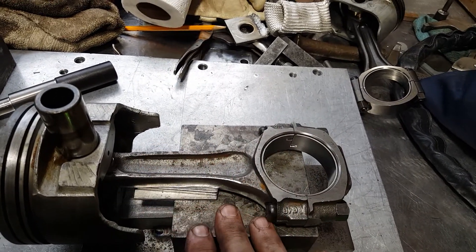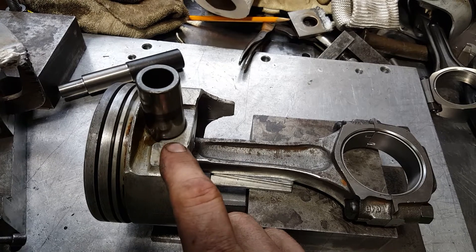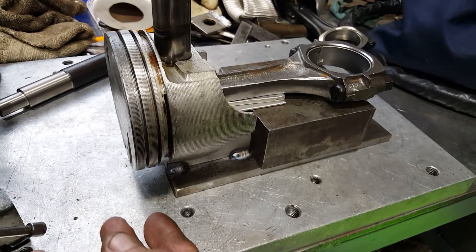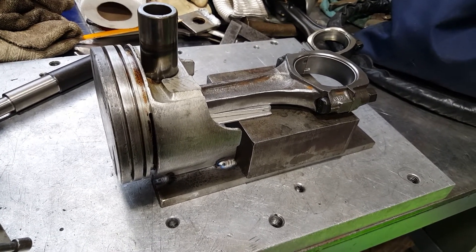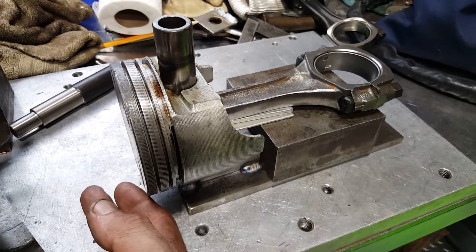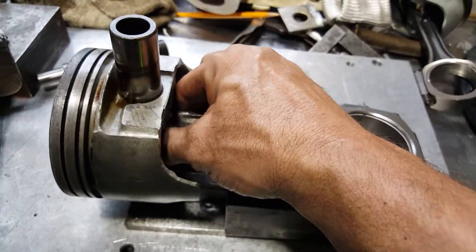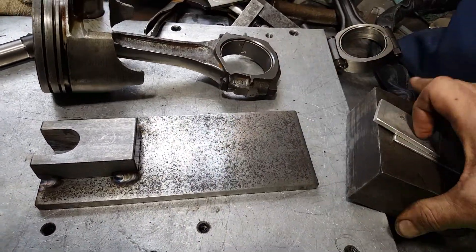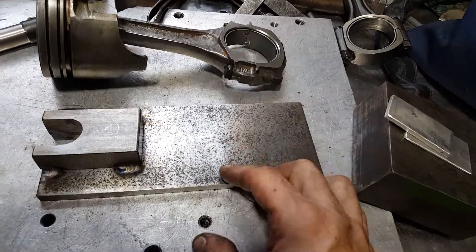This setup evens out the pressure on the rod — nothing moves. Where the piston is resting on the underside, there are little feet that hold it so it's not on the skirt. I've seen machine shops press pistons out, and even if you're not reusing the piston that's fine, but if you are going to reuse it you can't just put the skirt on your press and crank away — you're going to wreck your piston. Here's my jig.